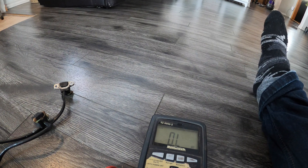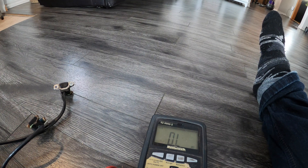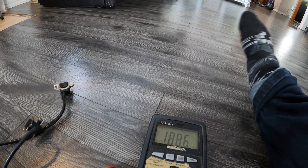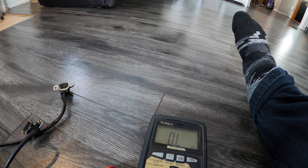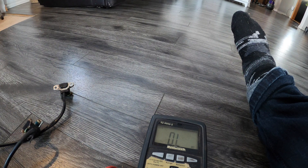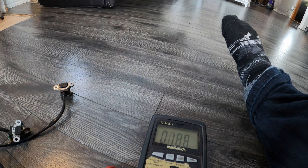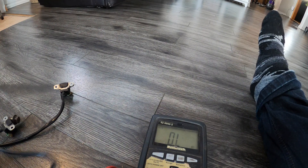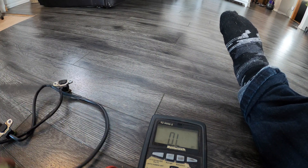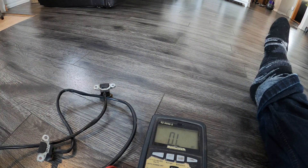Sometimes when you conduct these tests at room temperature and cold, it might not give you the same numbers as when the machine is hot. Sometimes sensor failure will happen when you're out driving the machine hard. Sometimes they'll die for no reason, then you get home and everything tests good. I recommend keeping the multimeter on the trail with you if you have a sled giving you issues like that. That's how you test those — they're basically just magnetized, as you can see the bit sticks to them.